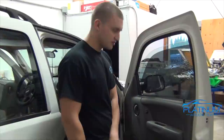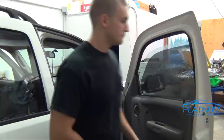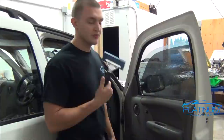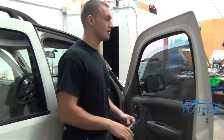What I like to do on these Jeeps is take my triangle — my Easy Reach — and as I'm spraying the water, use the triangle to push the water into the gaskets. Because these gaskets are tight, it helps loosen them up a little bit. I use a Bluemax, but I do not recommend it for beginners because it is a lot more unforgiving. When squeegeeing out the actual window tint, try to use the yellow turbo squeegee — it's a lot softer and more forgiving. If you hit the tint wrong with the Bluemax, you will crease it and have to start all over again.